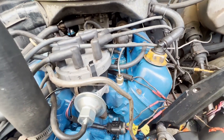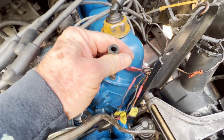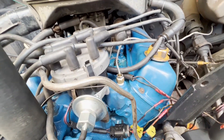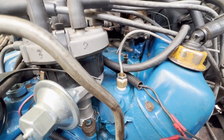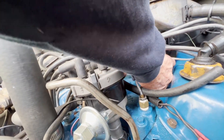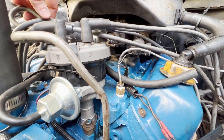This is what had flooded out big time. It is still wet down in there. Oh, look at that — you see that? There's problem number one right there. That is the vacuum line. I pulled it off yesterday as soon as I saw it just go super rich. I pulled that line off and plugged that vacuum port in there. So that's the vacuum that runs up to the power valve up under here. There should not be gas in there.